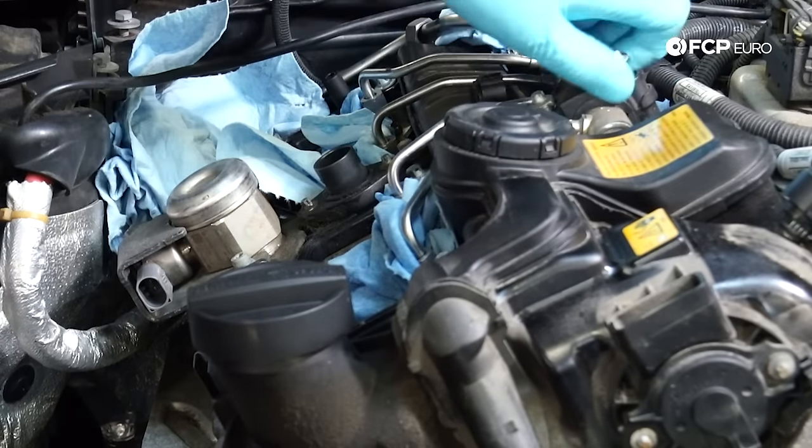These broken tabs and cracking, chain length that's longer than spec — and I can also see down here this is cracked and should be fully around. This is exactly the problem you see on N20 and N26 engines: these little thin areas cracking on the guides, and the chain is pretty stretched. You can see wear grooves from the chain sliding on it. If this doesn't hold itself in the correct location inside the engine, then the tension the tensioner is putting on it will be counteracted because it'll move out of position. Also — if you have an early production N26, check this sprocket. This 2012 car has the old-style smooth sprocket; the new style should have a laser-etched area. If you have the smooth sprocket, you need to replace it with the updated version — available at FCP Euro.